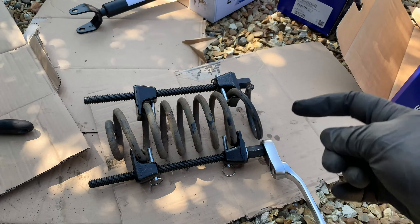I've got to take the tension off this one, but as you can see there's the other one - you can see how much pressure you've got to get on this. I have to be very careful as I undo it as this can kill you. That's the spring totally decompressed. Now I've got to do it again to this one - you can see how much I need to compress it to get that bit through there to put a nut and bolt on it.